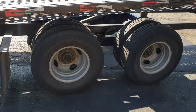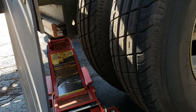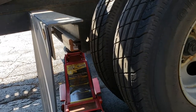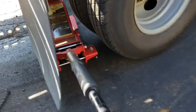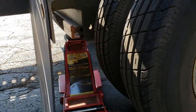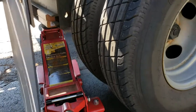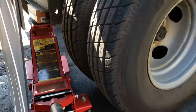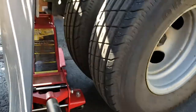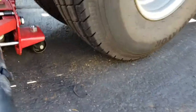I'm using a four-ton floor jack placed under a very strong section of the trailer. The spot I chose is a cross beam right behind the rear axle. I also used two blocks of wood to help with lifting. I'm going to lift the trailer until both axles and sets of wheels are off the ground about half inch to one inch.